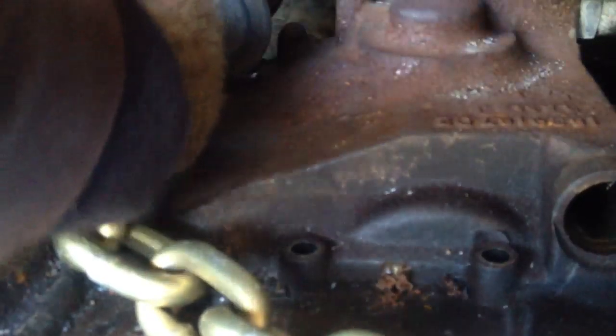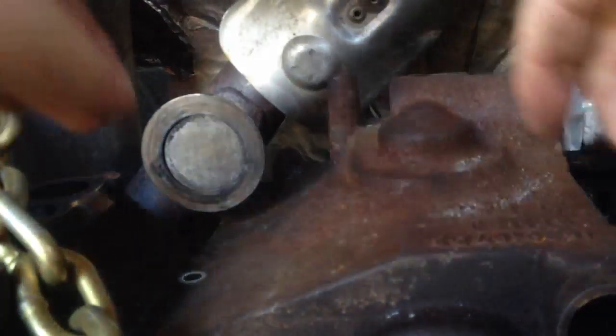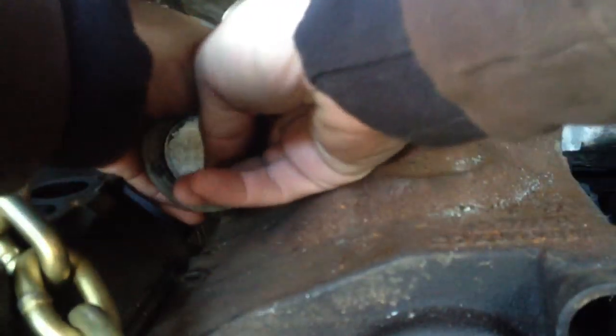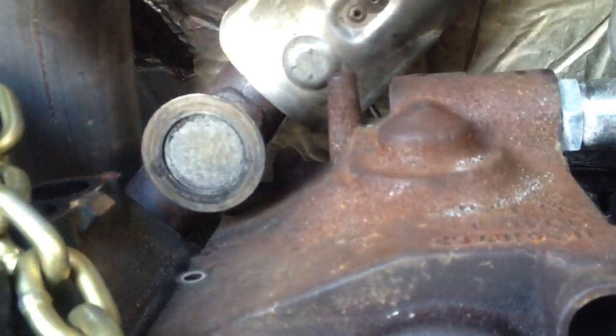For those of you who don't know, that's the IPR valve and this is your ICP sensor in the back. If you want to change those out or if you're ever in the process of changing them, the best way to access that is from the driver's side underneath the vehicle. There's a little shroud that goes in the back of that. You can access it with a little 10mm bolt — there are three of them that hold that shroud: two up high and one down low on the passenger side. Those are little 8mm bolts, so don't lose those.